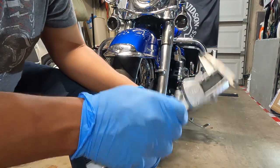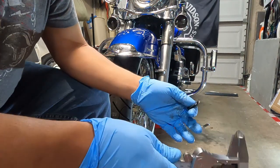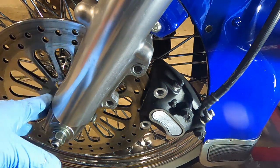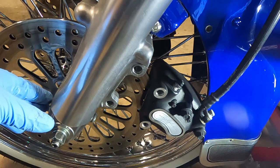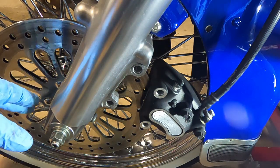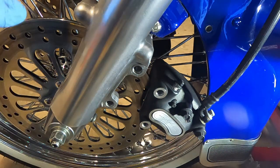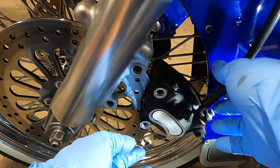Let me go ahead and put this stock spacer back in so I can show you what issue I was having and why we're doing all this work. This is the issue we're trying to solve — this is the point of this video. With the smaller 22-millimeter spacer in place — and if you're mixed up on metric versus imperial, I apologize, but I'll be referencing metric sizes — I've got the 22mm on this side and the stock 25mm spacer on the other side. When you go to put on your caliper, you hit.